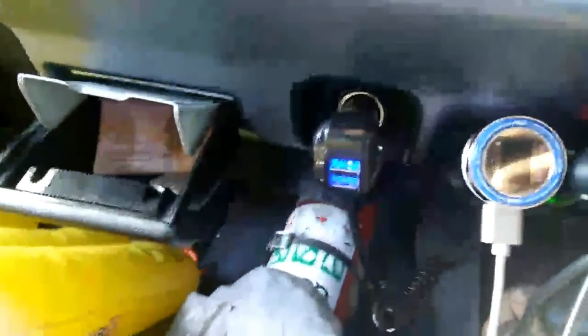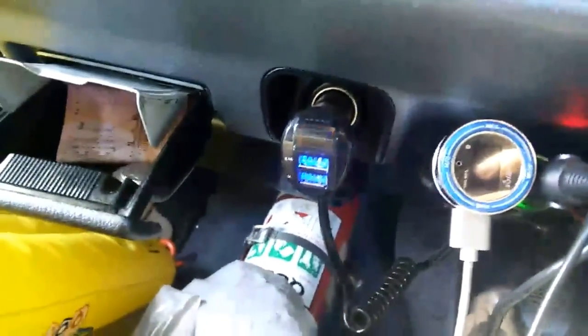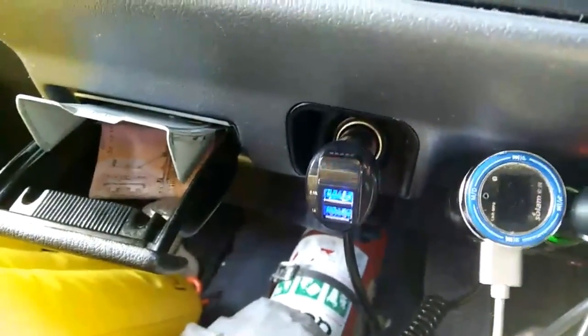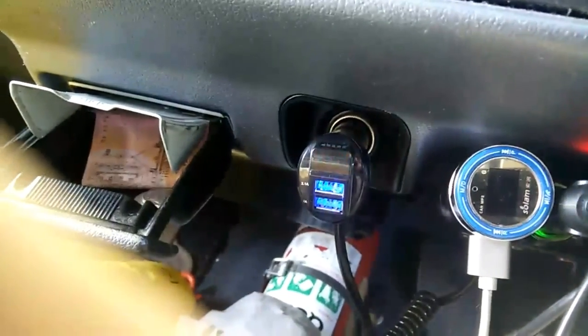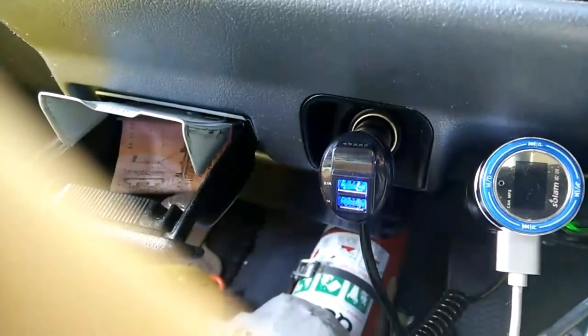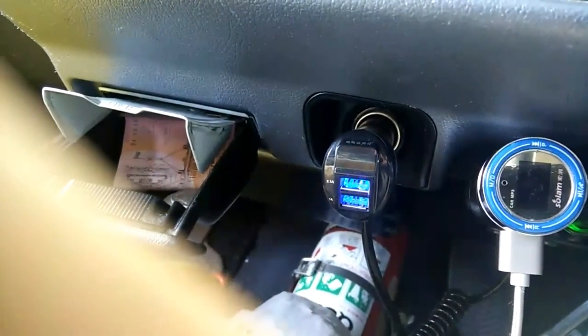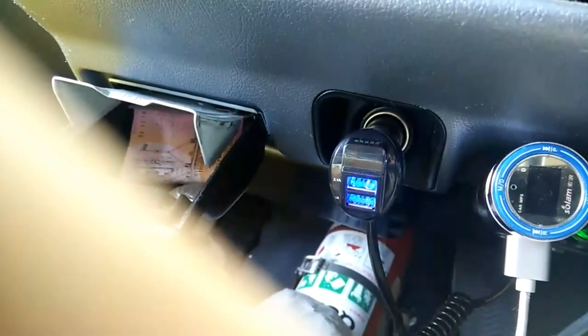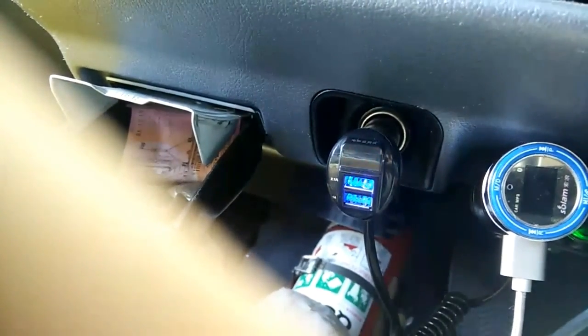It's blinking 15.1 volts with a cold alternator. When it's cold it will be much higher, and as the engine warms up — about a minute or so — it will drop back down to 14.8 volts. That's just showing the increase in voltage. It's blinking because it's giving a warning saying it's still a little bit high, but that's fine — it will drop down when the engine warms up.